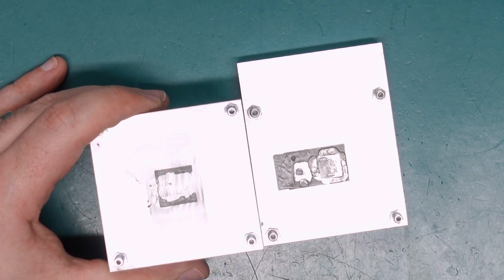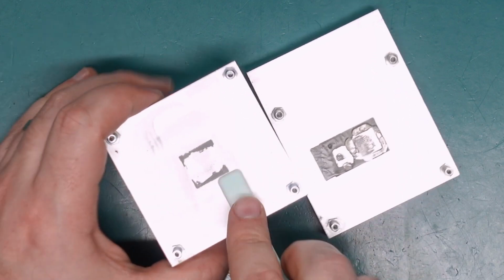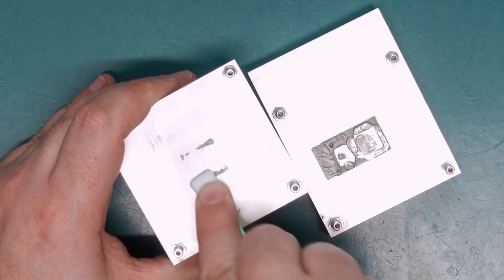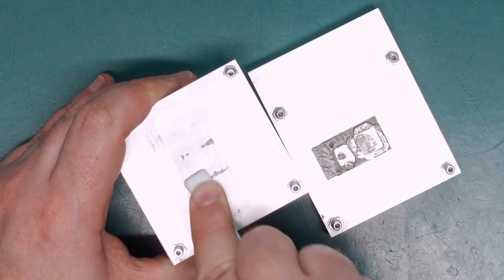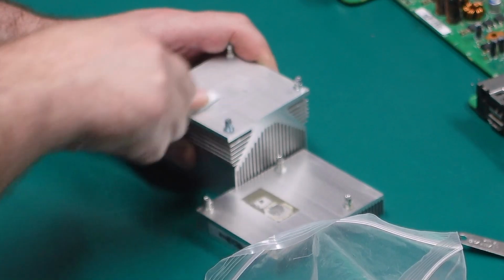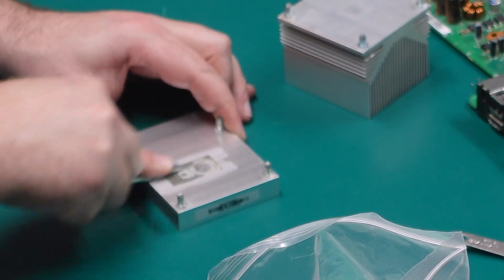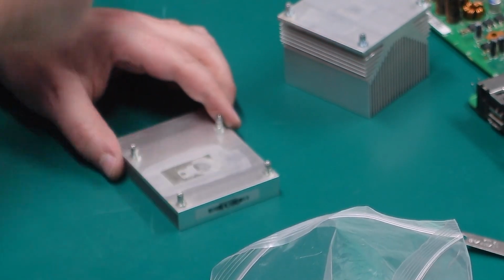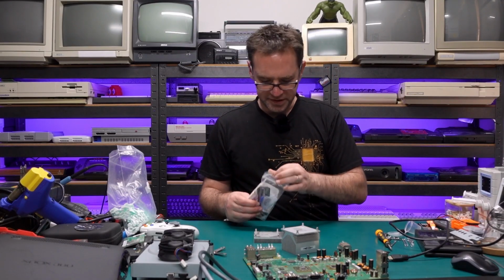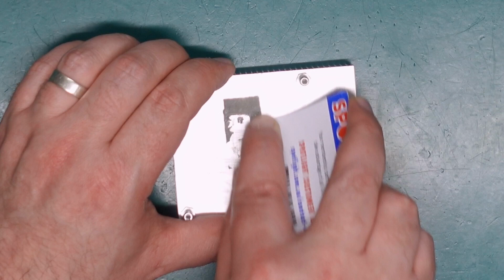Well, that's not bad. It's going to take a couple of these. They tend to absorb everything, which is good. But yeah, it's doing the job on this thermal paste slowly. And this stuff is horrible to try and get off at the best of times. I'm going to get something plastic and just scrape at it a little bit. Obviously don't want to damage the heatsink itself, but do want to speed this up a bit.